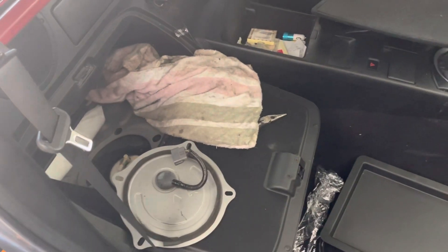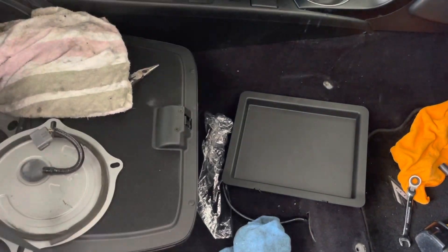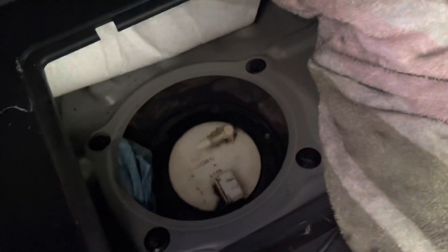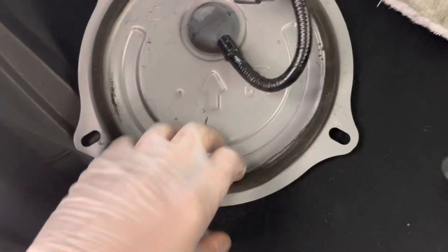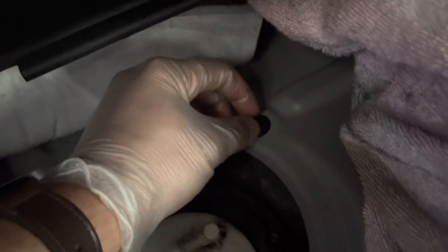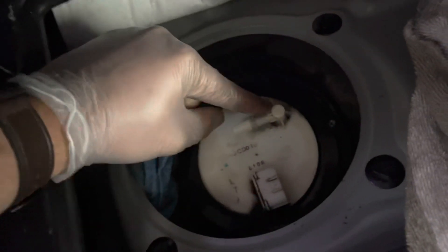As you can see, to get access to the fuel pump I took off the passenger side seat. Then you're taking off this collar and this thing just pops right out from this little cubby, and you have access to the fuel pump. There is a little collar like this with four things holding it in place — you just twist them with the pliers and it comes right out.